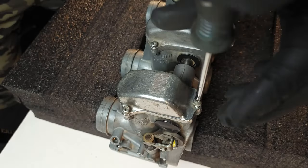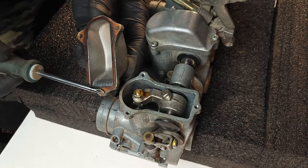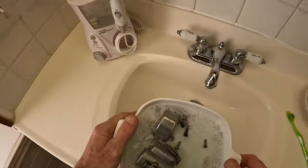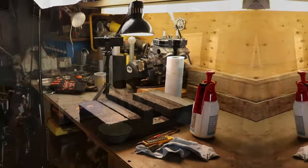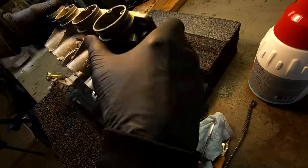Now we're going for the caps on top — I'm not gonna muck around under here too much, these are usually factory set. I'm just gonna replace the gasket on there and that's pretty much it. Keep all your bits for each carb together and separate from the others, then tackle the other three. There are all kinds of ways to get these parts cleaned up — I like to use an ultrasonic cleaner, but you can get great results just with hot soapy water and a toothbrush. Head out to the shed, spray down the inside of the carb with some brake cleaner, scrape off old gaskets, blow out all the interior holes and tubes.